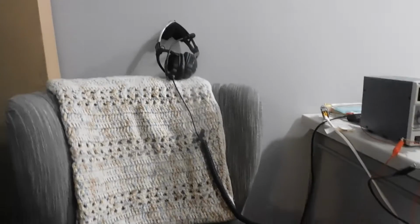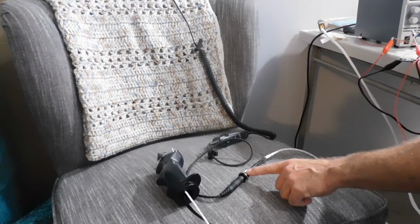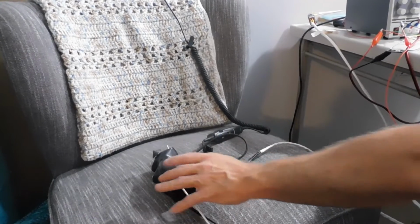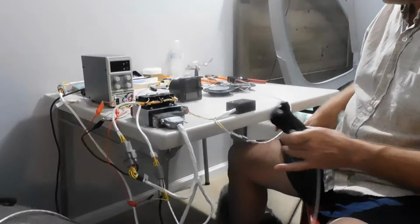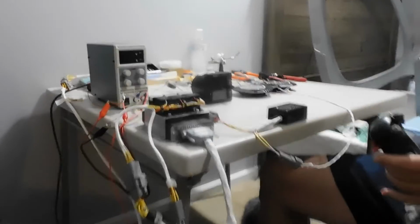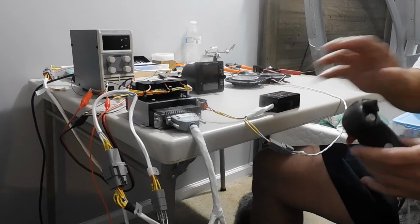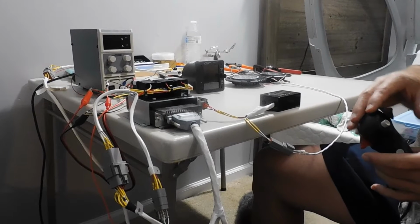I've got the A20, a really nice noise canceling headset, and so you have to build the wiring harness out to accommodate that feature. And then this system also integrates with the cyclic control grip, and there are features about the control grip that interact with the radio as well, and I'll demonstrate a little bit of that. And also I will show you my lights, because the lights patch into this circuit as well, so that you can control the landing lights with your cyclic control grip.